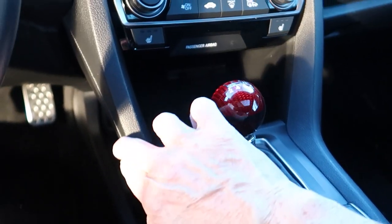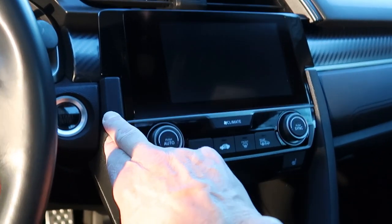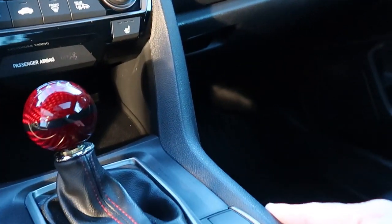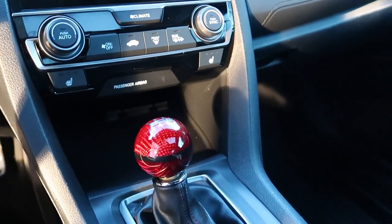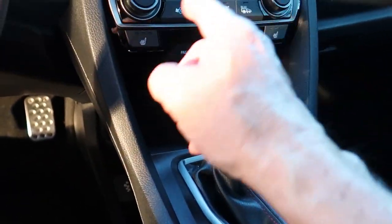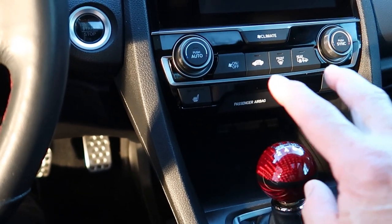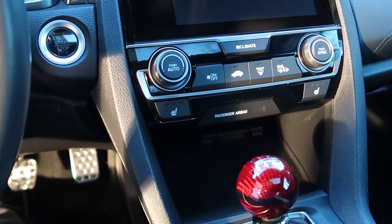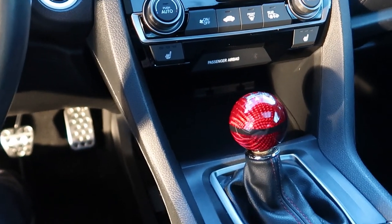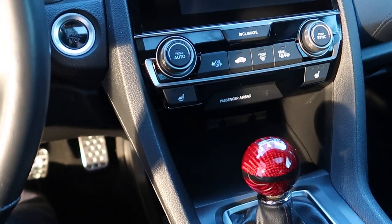The good news is there are just four Phillips screws and a couple of panel pieces to remove. We'll remove the driver's side piece first, then the passenger side trim, which gives access to four bolts. Then the head unit comes right out — it's really easy. Pulling the trim off is probably the trickiest part, but it's not that bad.